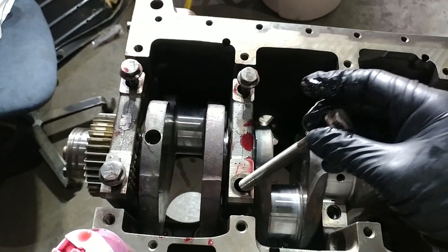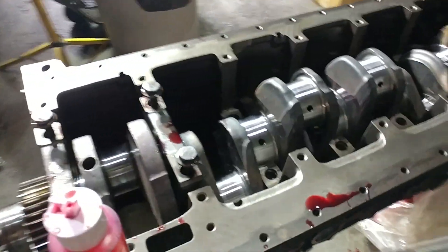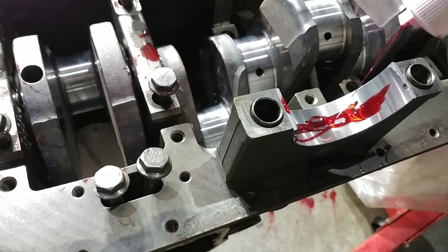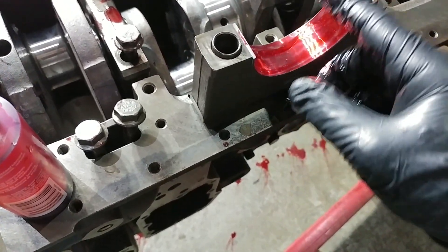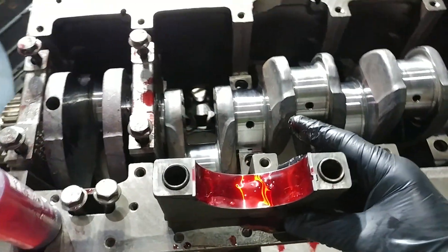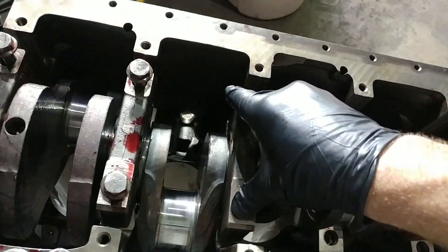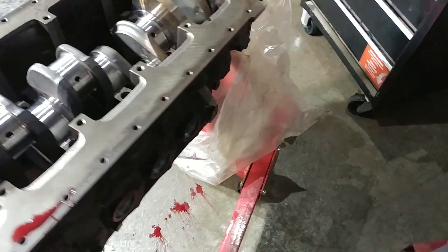All right, so I grab my bolts and then we're going to move on to the next one. So we're going to grab the next one, pull my bolts out, stick them out of my way. These have been pre-cleaned. These do not have any more plastigauge on them, there's no crap on them. They've been sitting waiting for this on a clean paper towel. So keep everything clean. Look at how sticky that stuff is — it's awesome. Again, overkill. Run it down the center. So this one's got our numbers towards the oil cooler. Let's get that thing seated. There's the posts, they're starting to line up. Push it into place. Grab our bolts. On to the next one.